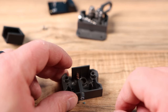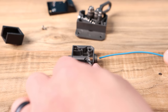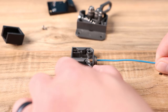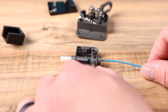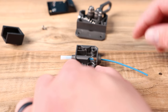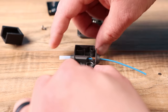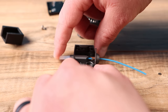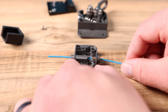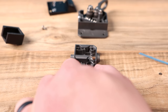I'm going to try to put some filament down through to make sure we're good now. I'll load it in where you would normally load your filament and push it through — and you can see there is a small PTFE lining right here in your extruder. I'm assuming that's just so it holds the filament path straight. You can see filament coming through both sides — it is moving like it should and not jammed.